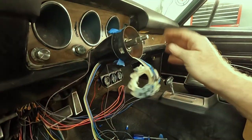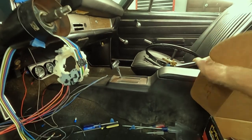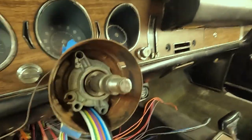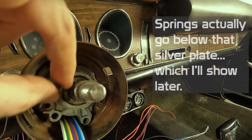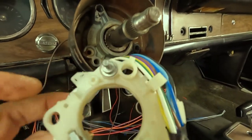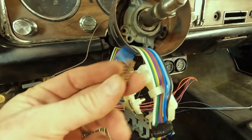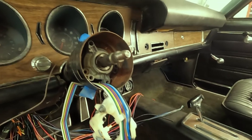I'm going to get this all hooked up, but I'm not going to put the steering wheel back on because I just realized this gives me a lot more room. I'll keep the steering wheel out of the way, get everything hooked up and put back together. Now, if you do have a Pontiac, they did a very evil thing — I found three springs down in here that had fallen out. Apparently each one of these springs goes into these holes, the three holes you use to screw this back on. There are springs behind this — I guess maybe to move it up and down with the horn or something. Luckily I found them and fished them out. I've got to make sure I get those back in correctly. This one also came with a little kit for the hazard switch — it's got a little spring, screw, and plunger for that.